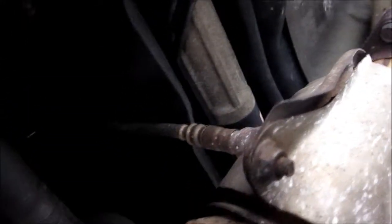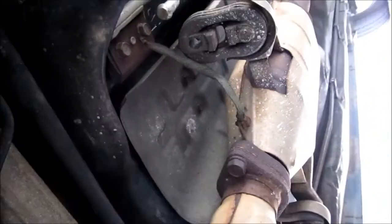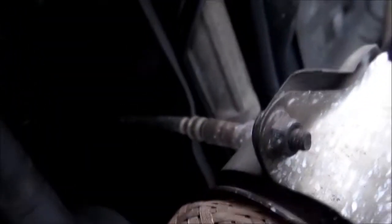And the other thing to consider, though, is that I absolutely have to fix this, because as you can see, that's the first O2 sensor, and that's after this exhaust leak. And so that causes really, really bad running, and causes it to run rich, bad gas mileage, low on power, the whole bit. I'm really surprised it hasn't thrown a code on me yet, but I'm guessing it could be any number of things. So I'm going to pick that out with a pair of pliers, if I can, so that I can get my repair to fit in there properly.